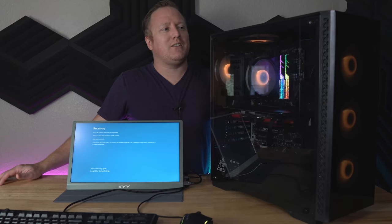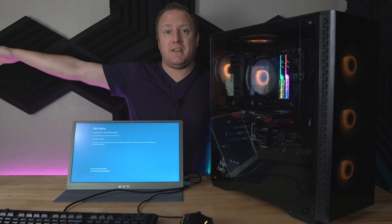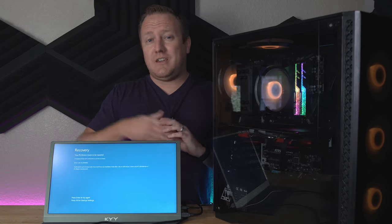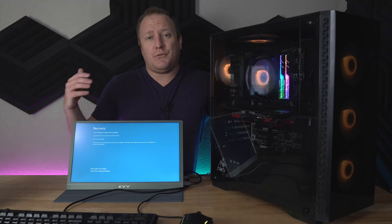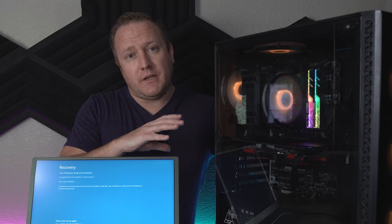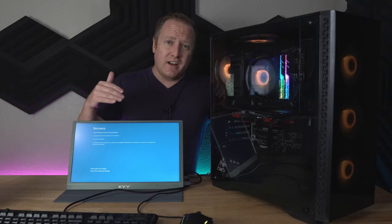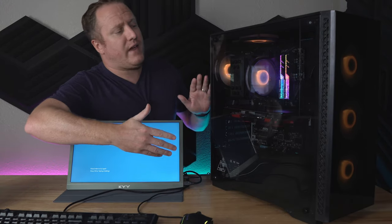We basically need to introduce more ventilation to that room. He could game with the door open to draw heat out through convection, or push hot air out with a fan at the door. Even if the AC is running in the house, if the door is closed he's introducing a heating element and it'll become uncomfortable. I don't really have anything else to say other than that's kind of just how it is. I did think about undervolting, but that involves a lot of trial-and-error and isn't a long-term solution since it can introduce instabilities — though it can definitely help with heat reduction.